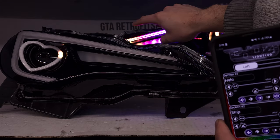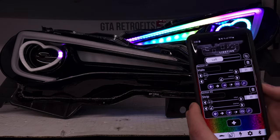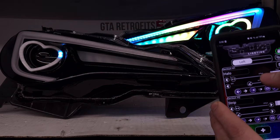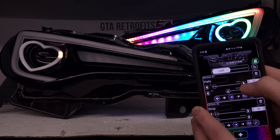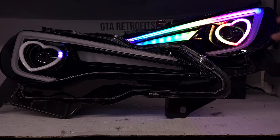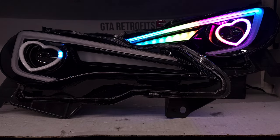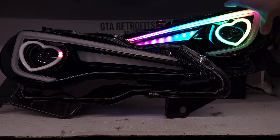What I want to do is use the yellow as our marker — yellow sweeps all the way across. We're going to take the offset and do it slowly. Yellow is still happening on the halo too soon. Getting better — a little too soon still. There we go. Now the yellow matches on the top bar and on the halo. On these particular headlights we have a choice: do we want this to come all the way around, or do we want it to start again from the bottom and meet up in the corner?